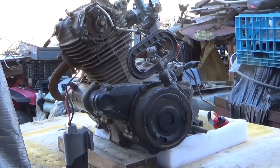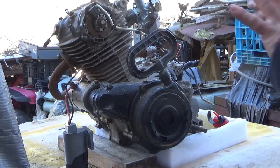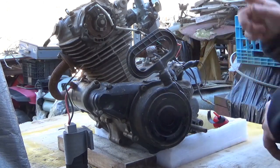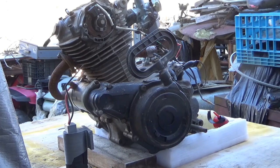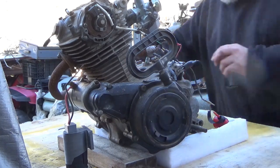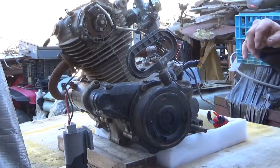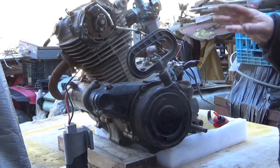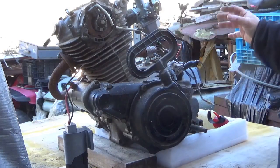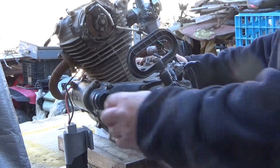Okay, we're ready for a cold start. While I was setting up I did put oil in it, and I did turn it over a bunch of times. I'm using 40-to-1 gas mix in it. So hopefully all those things make it happy. Idle is turned up, I'm going to try it without starting fluid. Choke is on, gas is on — she should be ready to go. Let's hope for the best.